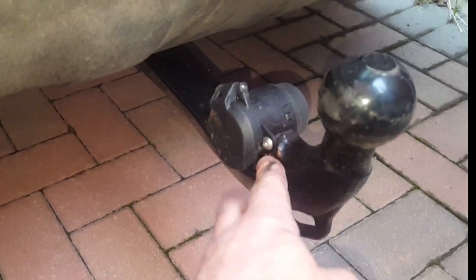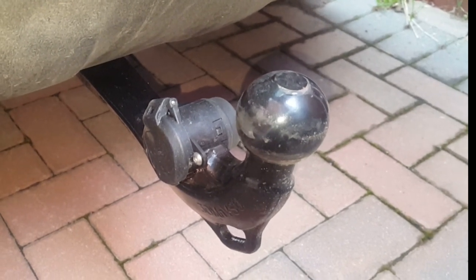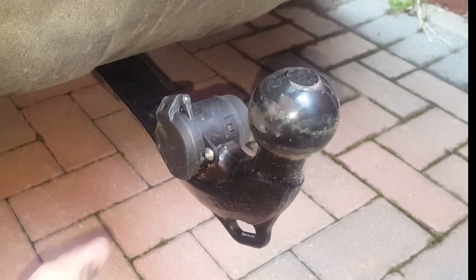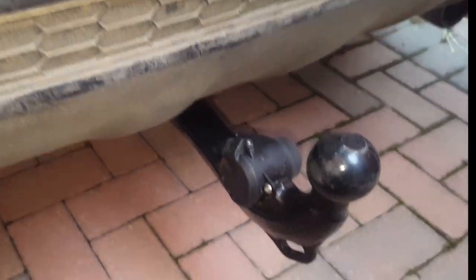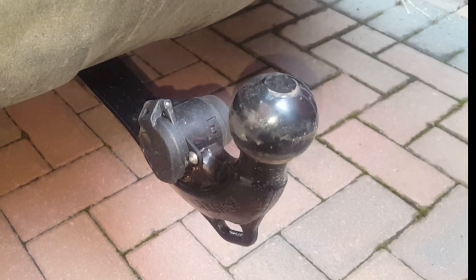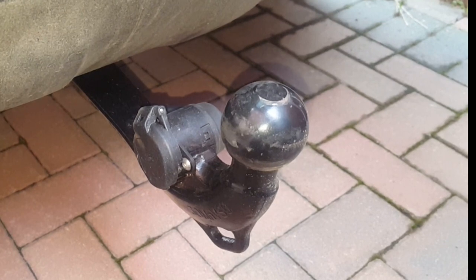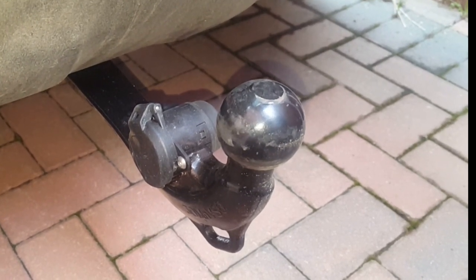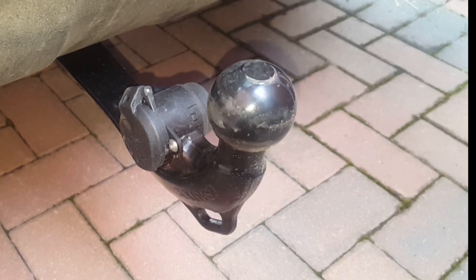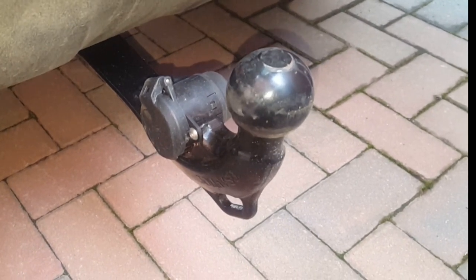This is on with the two 5mm pins and a bit of copper grease. Programming the tow bar didn't take long — they initially programmed the ECU that it had a tow bar, which made the socket work, the sensors do their business, and the fog lamp function where it turns off the rear fog lamp on the car but keeps the trailer one on. But what they didn't do was actually program the trailer module that it had an electric tow bar, which requires it to swing out when the car is in certain safe positions. The tow bar didn't swing down, but not for one minute did they blame me and the DIY electrics. They took the car back in and admitted they'd never programmed the module. So there we go — all good, fully operational.